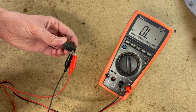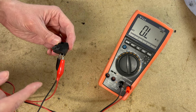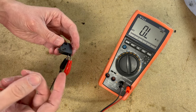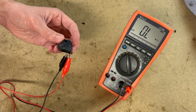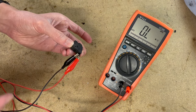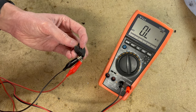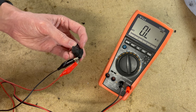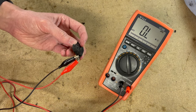First thing I'm going to do is test the switch. I've got crocodile clips here hooked up to my multimeter. This is a release-to-make switch, so it's kind of a fail safe. There should be no connection when you push the switch in, which we have. I'm going to try and squirt some contact cleaner in, cycle it a few times and see what happens.